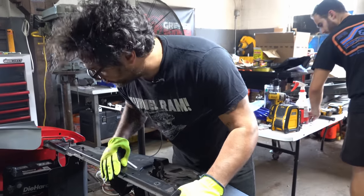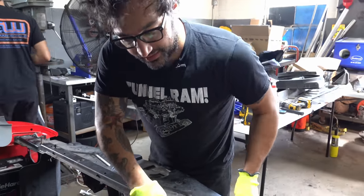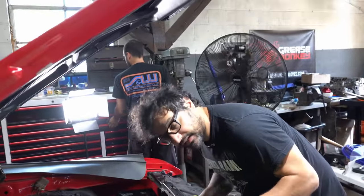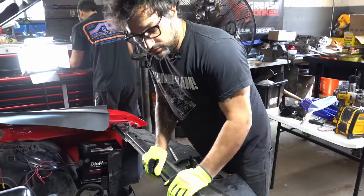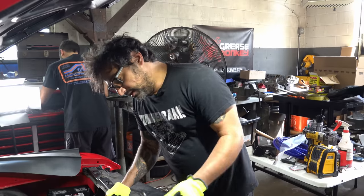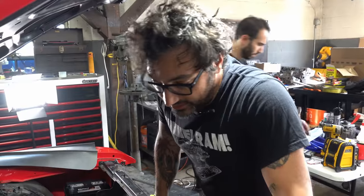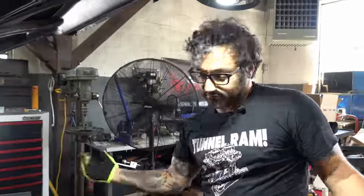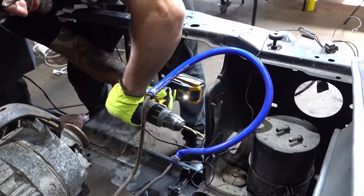All right. So this radiator support should be spot welded together. This side has three spot welds on it very clearly. And this side was disconnected and moving up and down with a bolt hole drilled through it. So we are just going to take 2 seconds, drill through this one side of the radiator support and weld it so this thing is solid forever. I don't know if there was maybe a minor hit up front, but nothing too serious. The frame rails are very straight. Whenever these cars get hit, it's super easy to tell. This part of the frame back there buckles, and this doesn't have that, so all good stuff. Drilling through this side and then letting it clean up the other side.